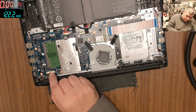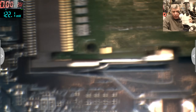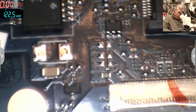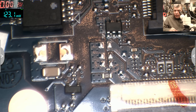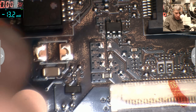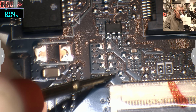Now I have the screen connector here and I can see a small fuse there. Let's check together. So that's the screen connector and we can see that little small fuse. You have two important things here — I think this one is the 3.3 volts track, which is for picture, and this one is the 19V, the main power rail voltage. Let's check the voltage there — we should have the battery voltage there. And we have... we have 8 volts. And here we also have 8 volts. Oh, that's bad.